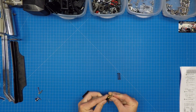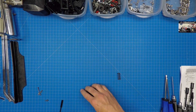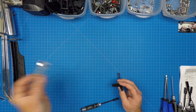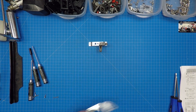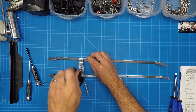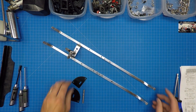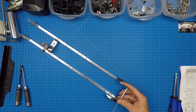With the shocks painted, it is now time to start the build. The first step is the steering servo saver mount, which attaches to the chassis via a cross mount. The cross mount helps secure the front assembly. Attach the cross mount to the pair of large chassis rods which form the backbone of the entire buggy. Finish the front with the metal spacer. You can leave the rear side stabilizers loose since you'll need them to secure the fuel tank in a later step.